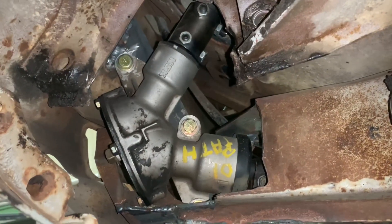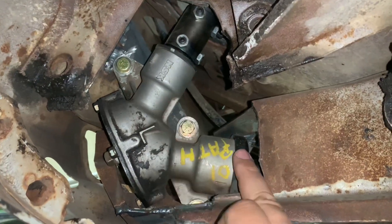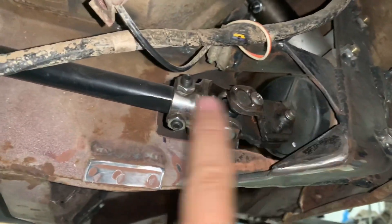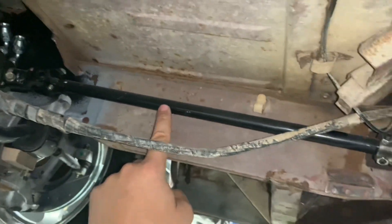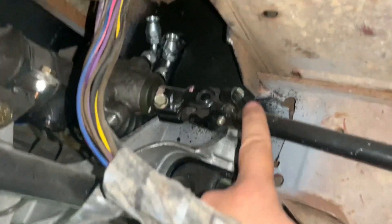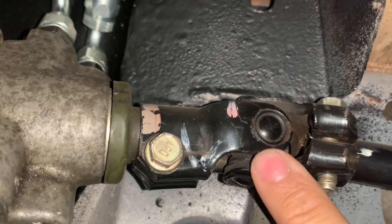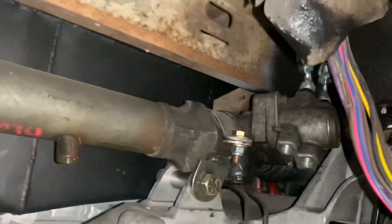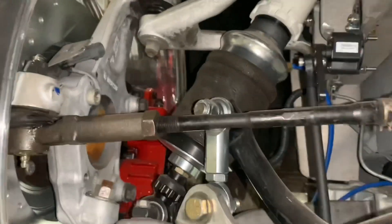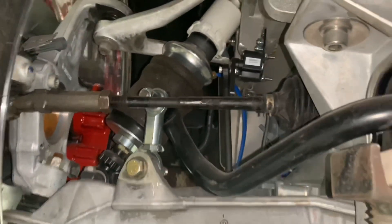Here's a look at the Nissan upper steering control box — this is out of a Nissan Pathfinder. It's a one-to-one ratio and it reverses the input to output. The output of that Pathfinder upper control box feeds into our steering shaft, which is actually the steering column shaft out of this Corvair — because this spline on this end matched the Nissan U-joint for the steering rack out of a right-hand drive Nissan Skyline. Fortunately, the stock 14mm tie rod ends for Corvette threaded right onto the Nissan Skyline rack with no modification needed.